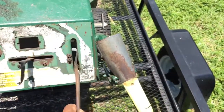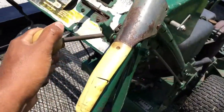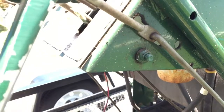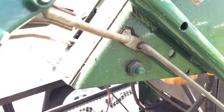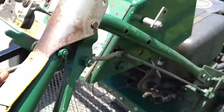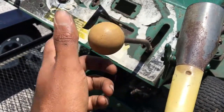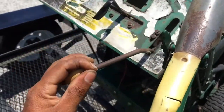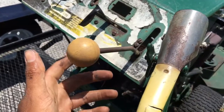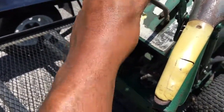When I moved it up to speed one, it would just automatically slip up on its own. The more it slips up, the motor goes faster. I was thinking it was the belts, but no — take a look here. As I'm moving this up, watch this bolt and nut — it moves as well. So what I did was tighten this down, because it was very loose. I tightened it down on this side and the other side, and now it no longer jumps. It stays wherever I let it go — right there, stays right there, no longer jumps.